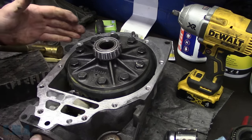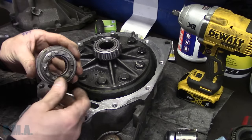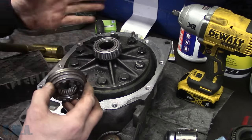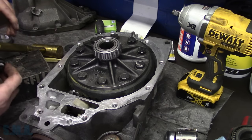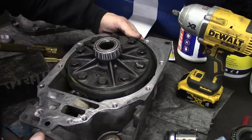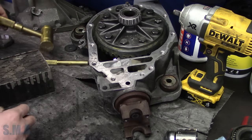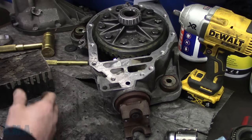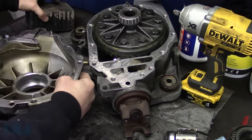With used gears, we have to set it up where the gear was. And unfortunately, with that lock tab broke, the adjuster had backed itself off and made everything loose. So that's kind of the predicament we're in. So I guess we can set this thing to the side. And there's a certain amount of torque that needs to be applied to set the preload on those bearings. So in this case half, we'll do the same thing.